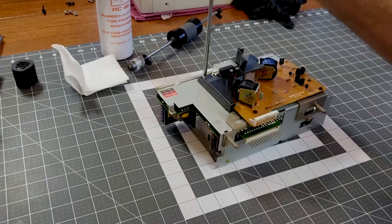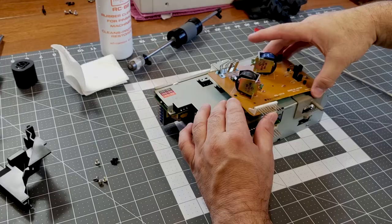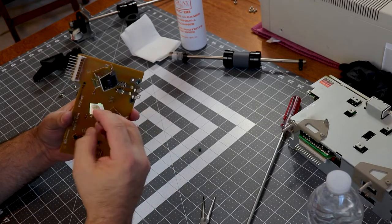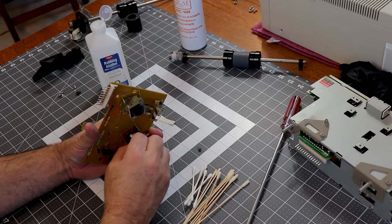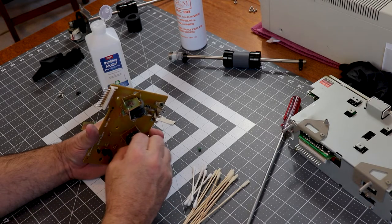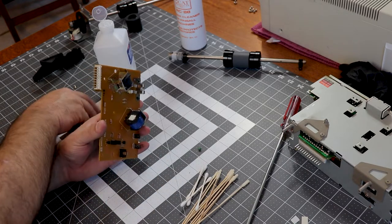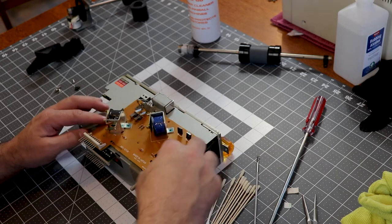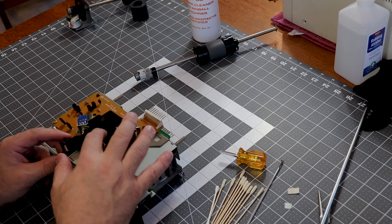Now I need to address the sticky solenoid plates. I removed the paper control PCA from the DC power supply and then removed the spring and plate from each solenoid. After cleaning both surfaces with isopropyl alcohol I used some very thin self-adhesive felt to replace the foam so the solenoids won't be abnormally loud and clacky. When replacing the paper control PCA it is important to reattach the safety switch cover and ensure the switches operate properly.